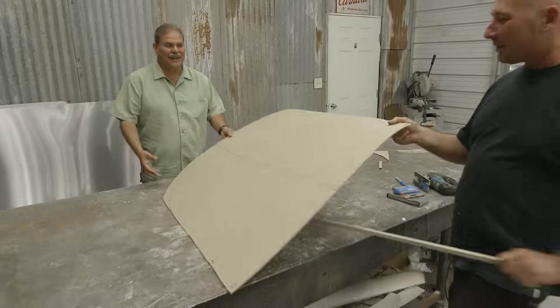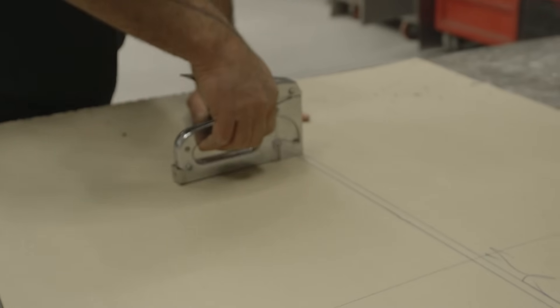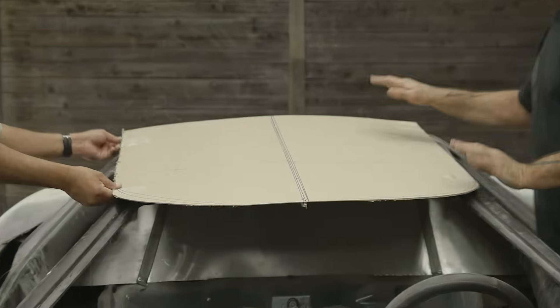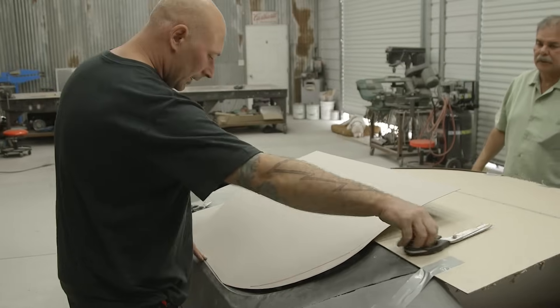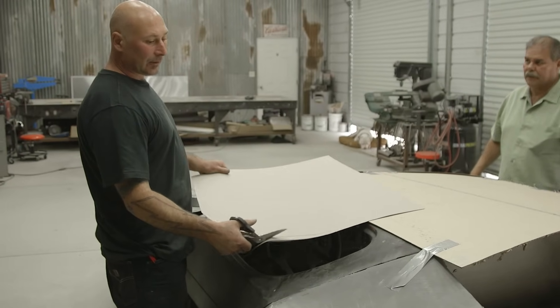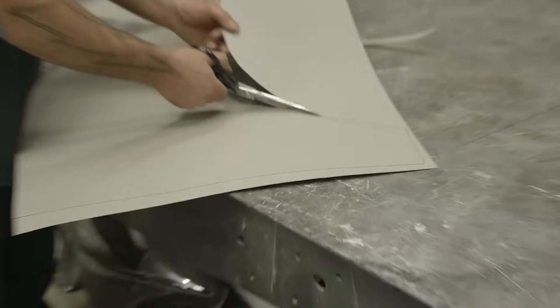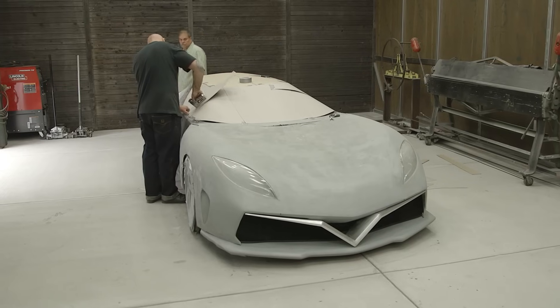With this idea of this curved windshield, a flat rooftop just isn't going to look right — it's going to look like somebody sawed the top of the car off. So it's got to all contour together to complement the nose. We've got our little arc down. I'm just going to make an exact template of this window and flip it over to that side, so this curve coming up around the back will turn around the exact opposite.